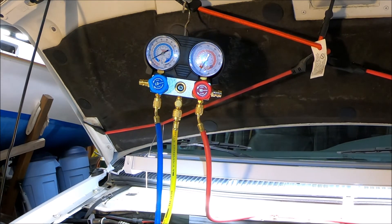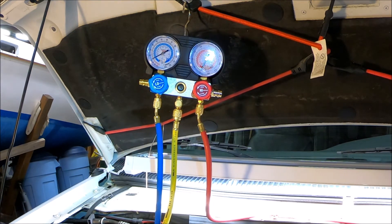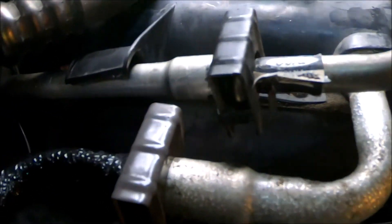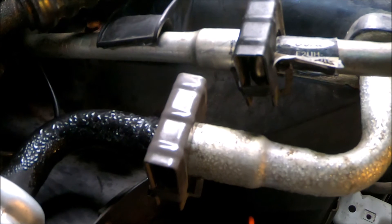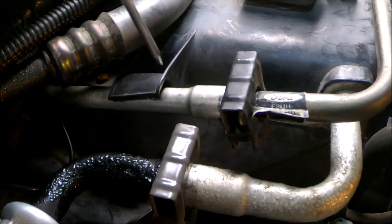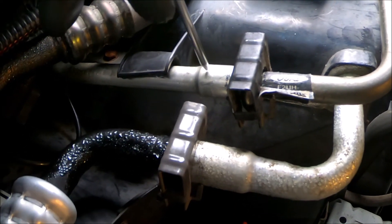So we're all done. The temperature coming out right now with the AC running should be about 48 degrees somewhere around there with the temperature and humidity for today, and I've got about 50 to 52 degrees — so being converted from R12 to 134A, that's pretty good. Once you turn it off it sounds like it's leaking, but it's not leaking. It's the pressure equalizing between the high side and the low side through the orifice tube. That's why your gauges should read about the same when it's sitting static with no compressor running.